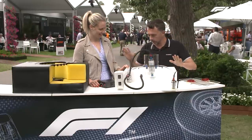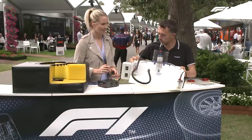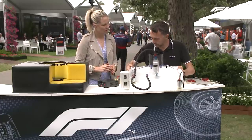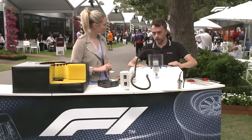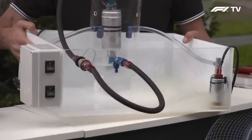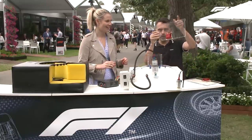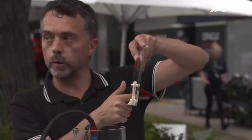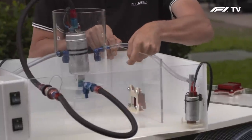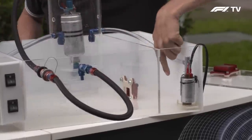This is more or less how the system works. But what can happen — even in this situation — if we go to Silverstone, Maggots and Becketts, it's possible that at some point when the car is in a corner, the pumps have no fuel to pump. This is mainly a problem when the fuel tank is low. When there is only a little fuel and we do a corner, it moves. So we baffle the fuel tank with this — a wall with a trap door that only moves in one way, only allowing the fuel to go in one direction. The fuel can go up to where the pump is but cannot go backwards.